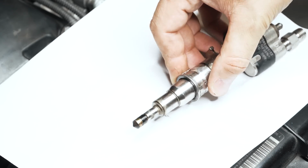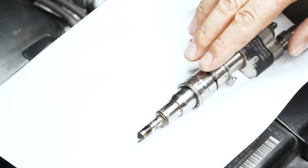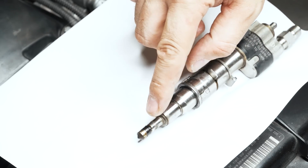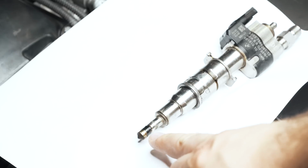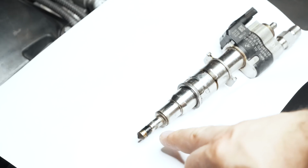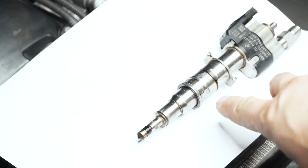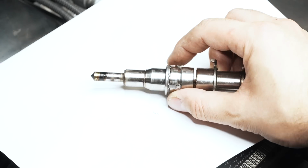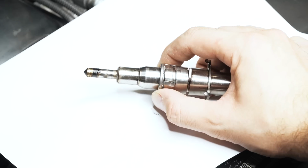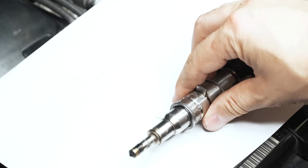So that's one thing. But I don't see the sign of an ovaled out bore or improper installation. But sometimes just with time, these seals can wear out. The hottest cylinders happen to be cylinder 5 and 6. So this will degrade faster than anything. If you guys have a problem, you may notice that these seals are absolutely missing and this is all just charred up. I don't see anything really discouraging there, except for the fact that this decoupler kind of doesn't really latch on some sides here. That's too much movement.